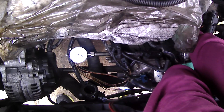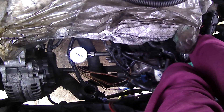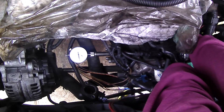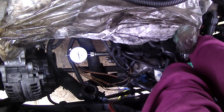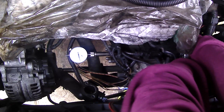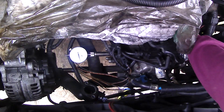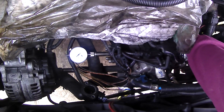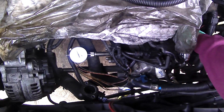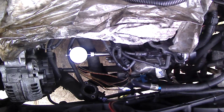That anti-clockwise direction is the direction of engine travel. There is a bit of tension trying to rotate it — pushing against the springs a bit. It's a little tight, so I'm going to hold it here and get underneath with a socket and ratchet, and see if I can manage it solo, because it shouldn't really need to be a two-man job.